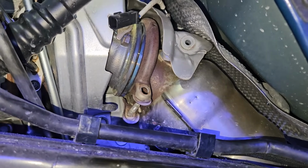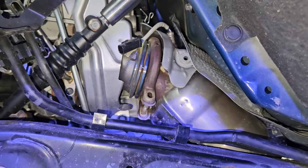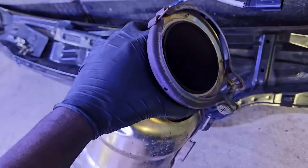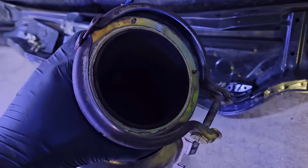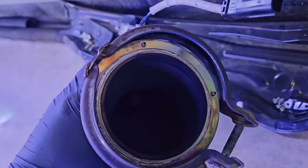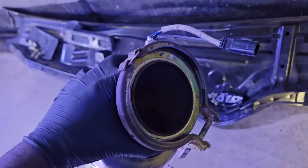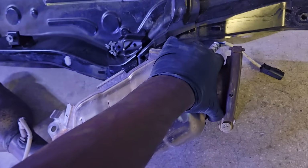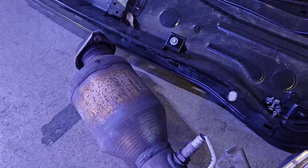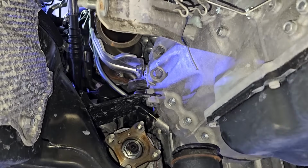This is definitely a two-man job. So while you're up here going through the wheel housing liner, you need somebody at the bottom to kind of help support it. Here you get a better visual while it's off the ground. You can see the two dowel pins there. That's what's going to line up on the turbo, so it makes it really easy for you to get the correct orientation when it's installed in the car.